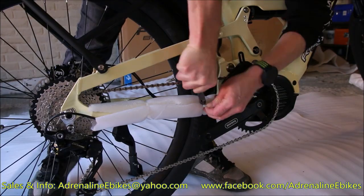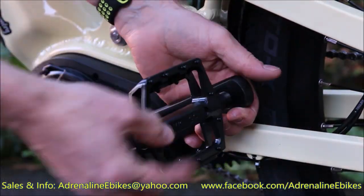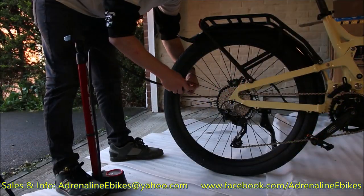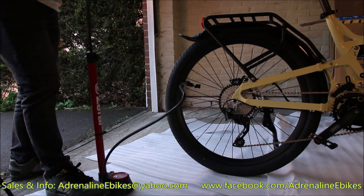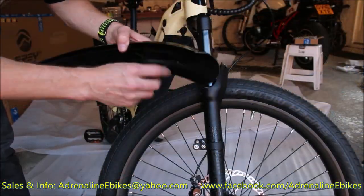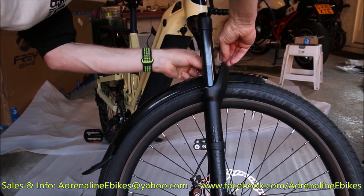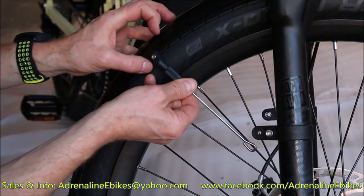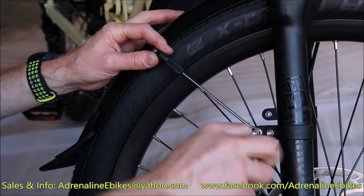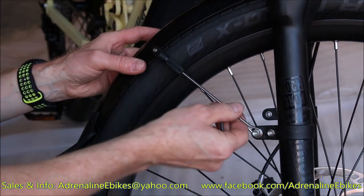Now just clipping off some of the other bits. We're going to look at the motor, cassette and drivetrain in a bit more detail in a little while. Bringing the bike outside now, fitting the saddle. It's got the SR Comfort saddle and Welgo pedals — just remember the left hand side one is a reverse thread, so be a bit careful with that. Now just pumping the tyres up, putting about 40 psi in. Now we're putting the front fender on — there are a couple of cable ties that go round the top arch of the fork. What I recommend is that you just loosely fit all of these hold-off arms, jiggle everything around until you get it positioned right — it's quite close tolerances. Then once it's all nicely positioned, do the other side of the fender and tighten everything up. That's the best way I've found of doing it.